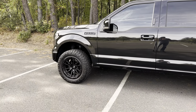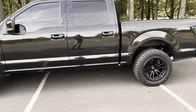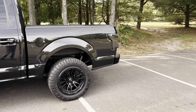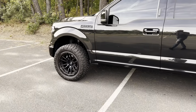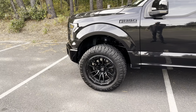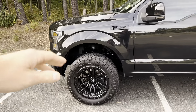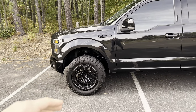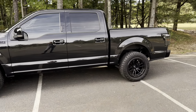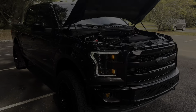In terms of lifting this truck, I really didn't want to do anything crazy. This is a daily driver — my kids get in the back and everything — so I don't want to be obnoxious and do a crazy 6-inch lift or anything like that. I ended up just doing a front level kit. This is the 2.5-inch level kit by MaxTrack. Basically it's like a hockey puck that sits above the struts. What it does is actually level out the front, since from the factory the front sits a little lower than the rear for towing capabilities. Now the front and rear are nice and level.